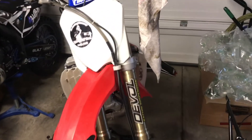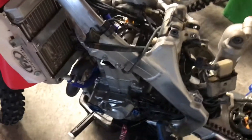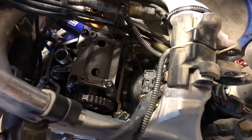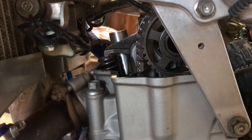In this video I'm going to show you how to shim your valves on the 2009 to 2011 CRF 450. This procedure is common across all machines — the specs are just different. I already have the fuel tank off, I removed the rear shock and subframe to make it easier to access the intake valves, and I pushed the throttle body down and out of the way. Valve cover is off, timing plugs are off, and I already have it at top dead center with the hash mark aligned with the sealing surface of the cam cap.